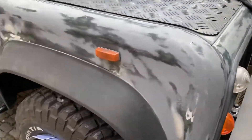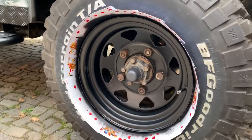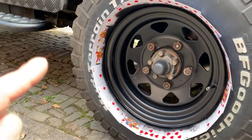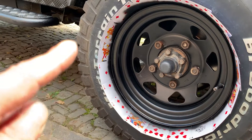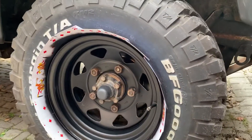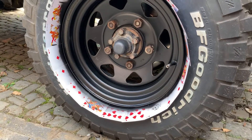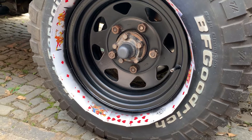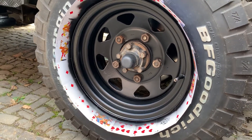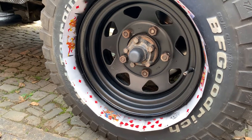The grill's off at the moment and a little trick I learnt was how to spray wheels on a car. I've left them there as you can see them. This is just a pack of playing cards and you just put the playing cards in between the tyre and the wheel all the way around — just one pack for two wheels, two packs for four wheels, and they're about a quid each. It allows you a nice seamless run around your wheel so it looks pretty good when you take them off. I'm just letting the paint dry now so I've just finished it — that'll look a pretty good one when it's all done.